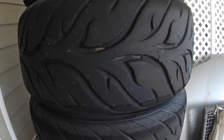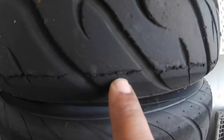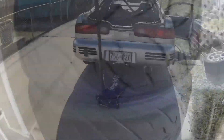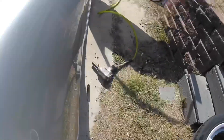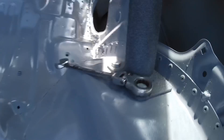The first thing I'm going to do — when I put the auto power roll bar in I got inch and a half bolts, and on hard times it hits the tire. It's not really deep, just cut all the way around. I only use these tires for track, so that's the first thing we're going to work on. I already have the car jacked up and the rear passenger wheel removed.